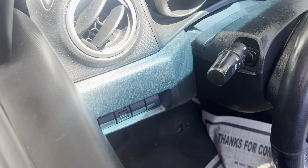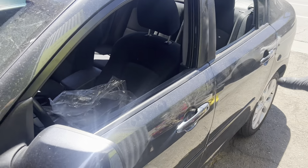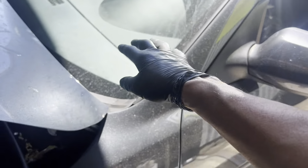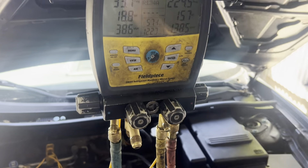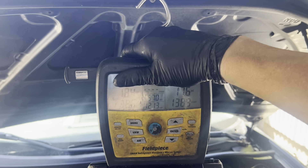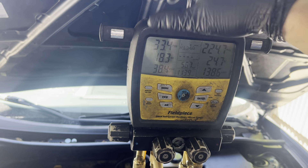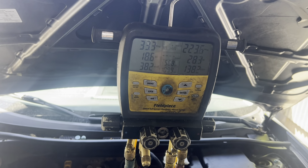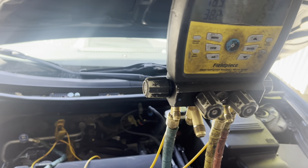We've got cooling now — we must be down in the 50s, high 40s, 50-something. It's nice. We're under sun load, baking the interior — it's a black interior on a dark silver-gray car, black plastic dash gets really hot. I'm going to stop right there because I know I have a leak out of the dash. That might be what caused the old compressor to burn up, or it leaked out the front shaft seal — maybe somebody squirted so many bottles of refrigerant in it that it blew out the front shaft seal.